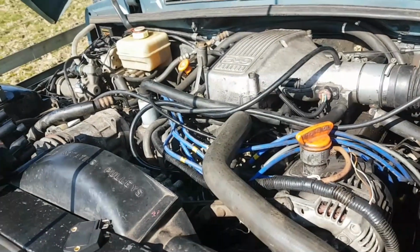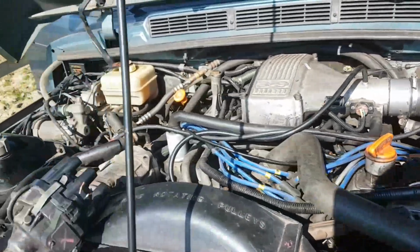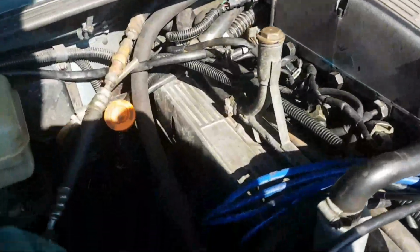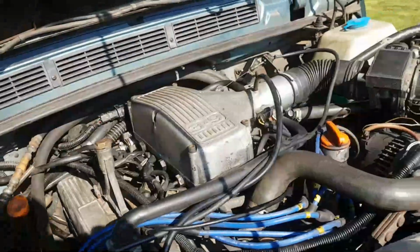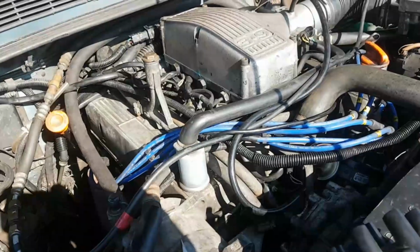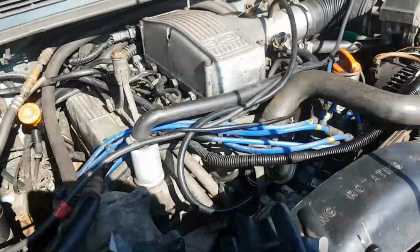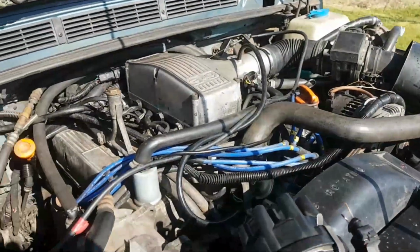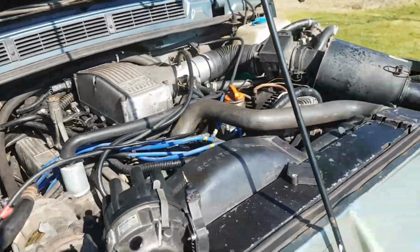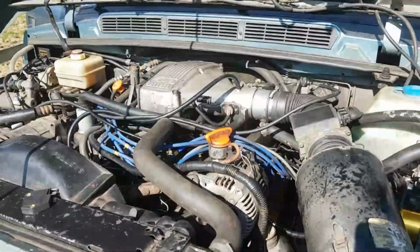So I thought, well, this is bloody weird. Is it fuel related? This is kind of where I discovered the filter issue on the pump. So I was taking the plugs out, because we've got new catalytic converters on this thing, and it's crazy to crank this thing over for hours on end. You can overheat the starter motor. All you're really doing is putting fuel into the cylinders, which is not igniting, which is going to end up in the exhaust and damage the catalytic converter. So after about 20 seconds or so of cranking, stop cranking, take all the plugs out, let the thing dry itself through, put the plugs back in again, try it again, and it became a very laborious process of trying to get this thing to behave itself.